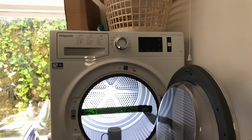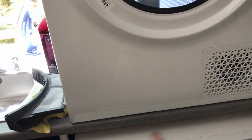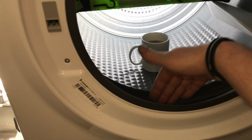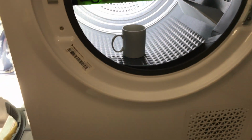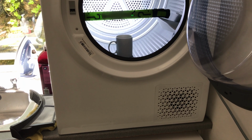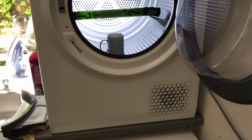So hardly a public service announcement, but for that particular model, a tumble dryer, if you've got one without the door here and it's not drying the clothes very well, that's your problem. The filter, the other non-removable filter that's down here, that's your issue. So brush on a stick, give it a little wipe over, get a vacuum on the fluff, get all that out, and between cycles take those two filters out. Don't leave those filters in there. Then you will encourage that moisture that's on the filter, the third filter, to dry out.